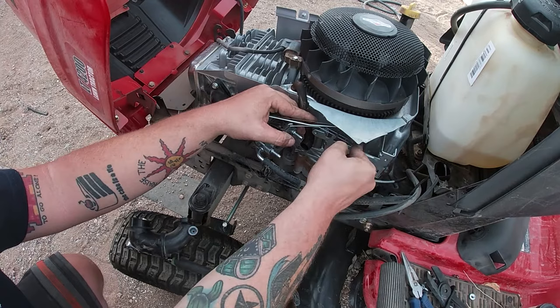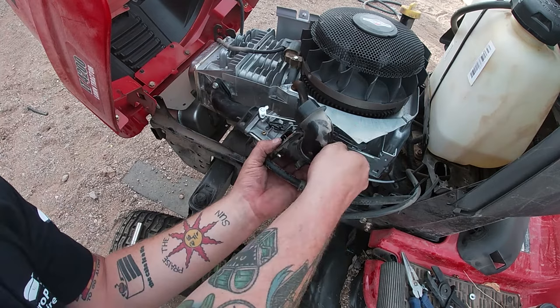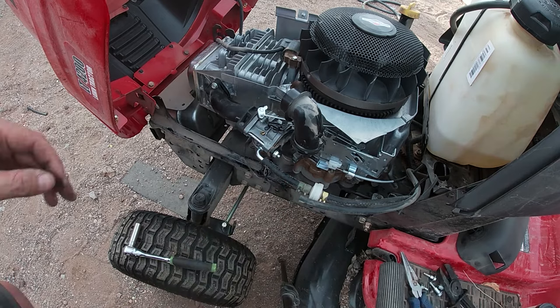Yes, I can't stress it enough. Do not do what I just did, because if you broke it or bent it, that's a pain to replace that carburetor. I mean, you can do it. It's pretty cheap for an aftermarket one. But why even bother with it when you just do it right? And that's why I'm telling you, before you tighten on the intake, put your linkages on.